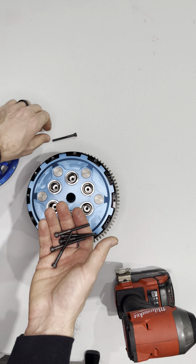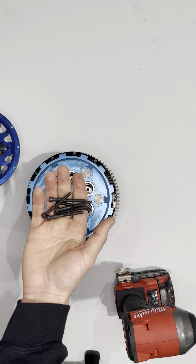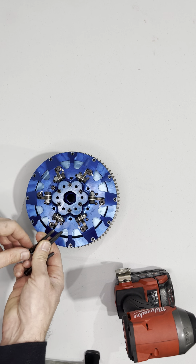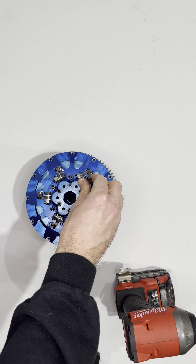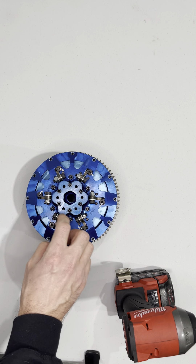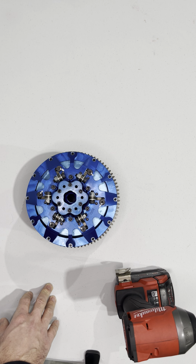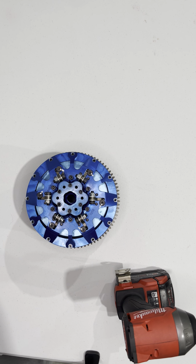So really quickly, just wanted to demonstrate what these bolts are used for when working on your clutch. And as Dustin would say, he throws them away — that's totally up to you, but he doesn't use them. The only other thing I'll add is that I have seen people forget to take them out before. That's another no-no you've got to learn the hard way, but that can definitely damage your clutch and obviously keep it from operating the way it's meant to. So if you're doing clutch maintenance, always remember to take these static spring holders out and you'll be ready to rock.